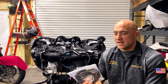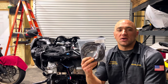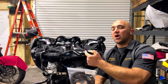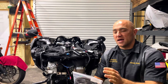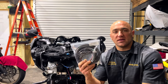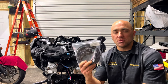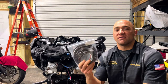Our passive saddlebag lid harness is exactly just that. It's a single run of oxygen-free copper speaker wire that will go from the fairing of the Indian Challenger Pursuits all the way down the backbone to your saddlebag, both left and right. These are pre-cut to length, loomed with quick disconnects that are waterproof for the saddlebags, making it 100% serviceable if you ever take your saddlebags off easily.